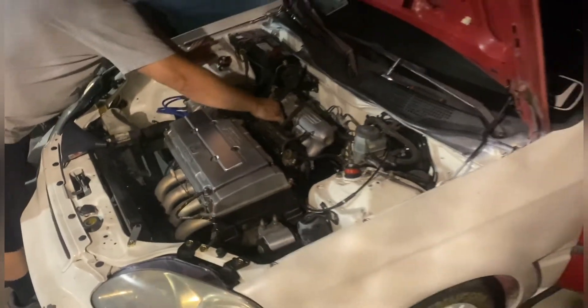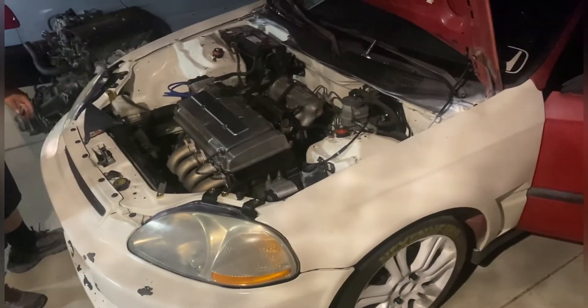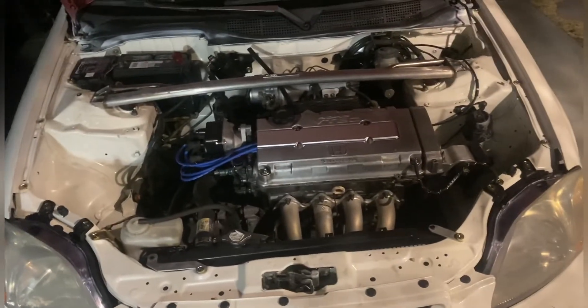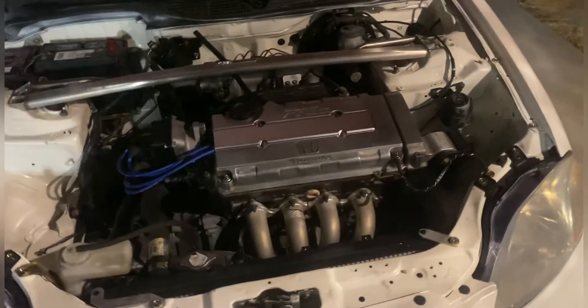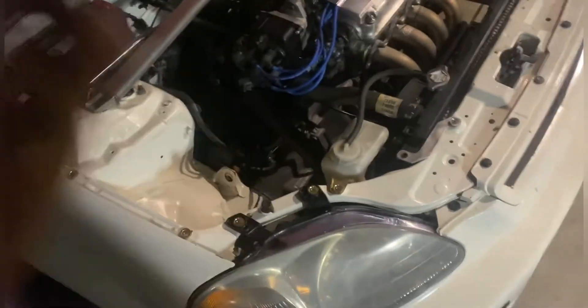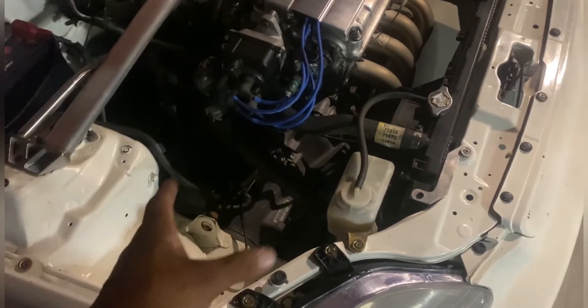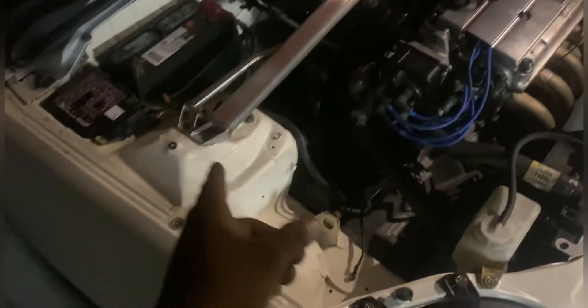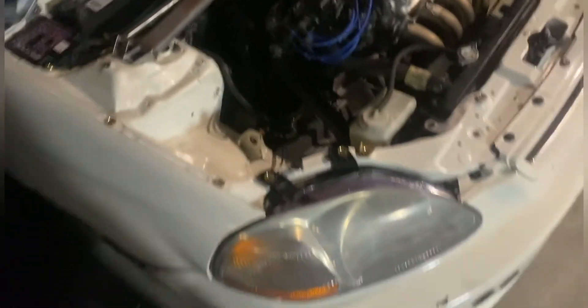There's still a lot of things we need to do before it hits the street. Axle nuts have to go back on, cotter pins have to go on the lower ball joints, and then the brakes have to be done — then it should be road worthy. We had the transmission on its side and it was not leaking oil, which means there is no oil in the transmission. We didn't even let it warm up because it's not good to run it without oil in the trans. We'll load it up with some 10W-30, finish topping off the radiator, and reattach the strut tower bar.